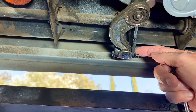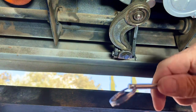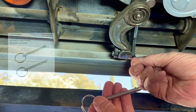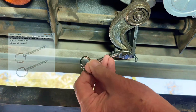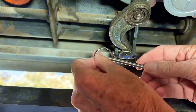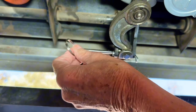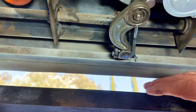We're under the steps now. What we're going to focus on is this little pin right here. If you ever have to repair your steps, take this pin out and put this one in. I replaced the cotter key with a hairpin here. I'm not going to pull this pin out because it's not broken, but if I ever have trouble again, I'll put this pull pin in right here. It doesn't need a cotter key — it's got this little ball on it. It's a quick pull. You simply pull it out. It's a quarter inch in diameter and three inches long. That will release the steps from the motor and the linkage, and you'll be able to move your steps in and out freely.